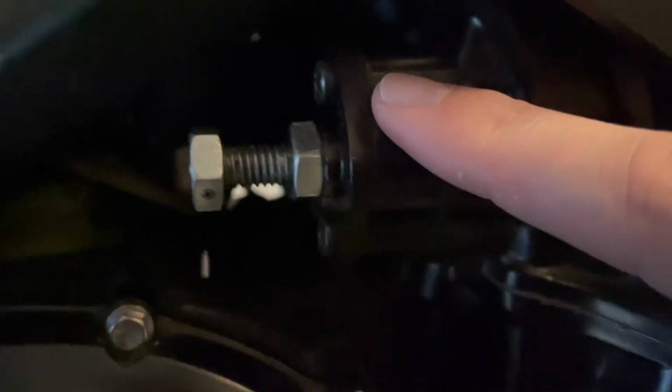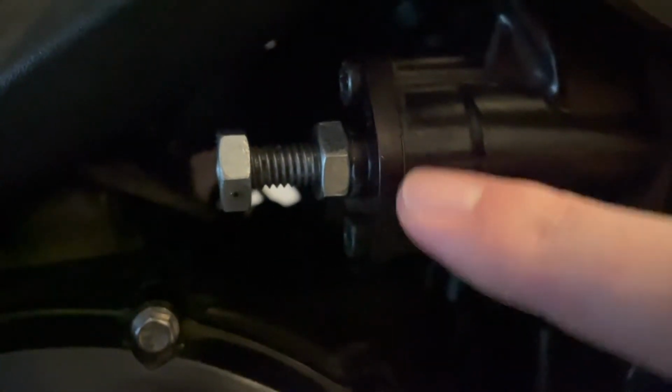According to the RTV, you're supposed to get the bolts about hand tight just until a little bit of RTV gets squeezed out of the mating surfaces here. So I wiped that off, waiting an hour for it to cure per the instructions. After that, we'll torque these two bolts down and let it sit overnight, and then move on to changing the oil tomorrow or Wednesday.